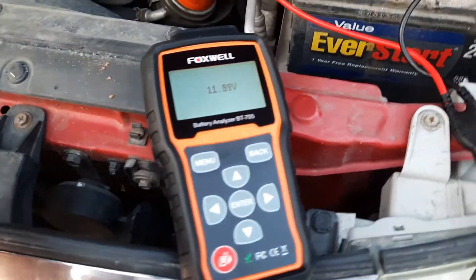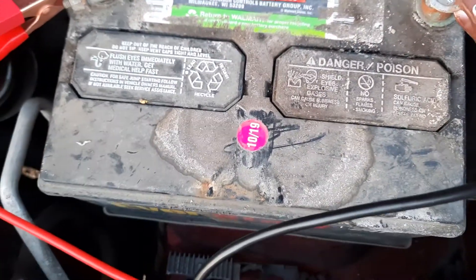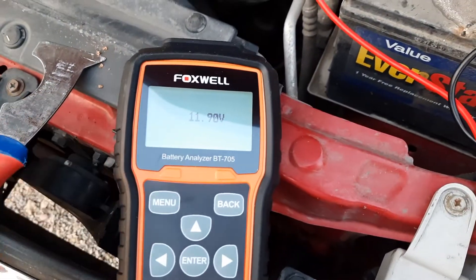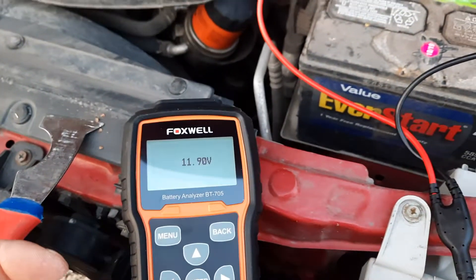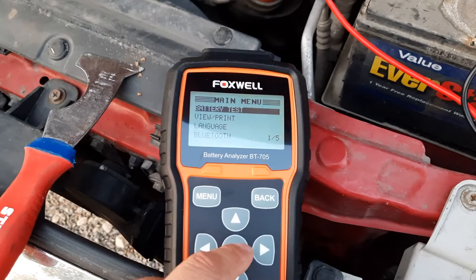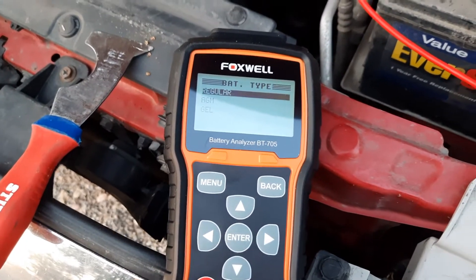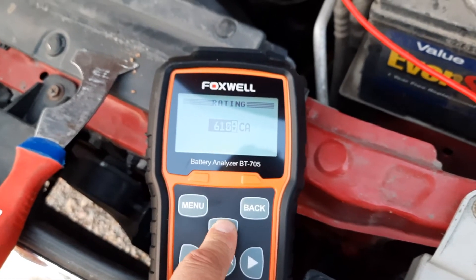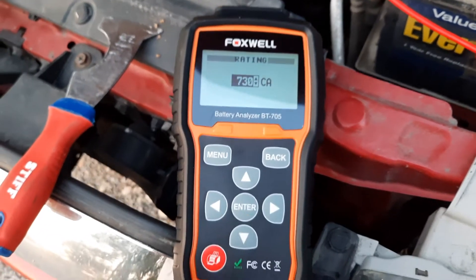We're going to do a test here with the battery. This battery is the same one I created on 10-19 and I stuck it in here and it's been running strong ever since. Now the battery voltage settles over time. When I pulled it off the first time it was 11.92. It's dropping just a tiny little bit, fluctuating just a little bit, but it also has a slow draw on it from the vehicle. Let's do a start, let's do a test. It's a 12-volt system, in the vehicle, top post, regular. Let's go with cranking amps — 730, and 30, because that's what it says at 32 degrees Fahrenheit. And we're just going to hit enter.